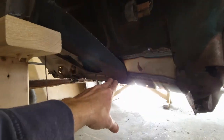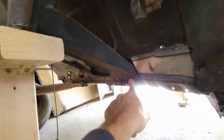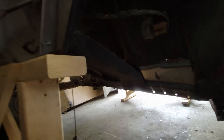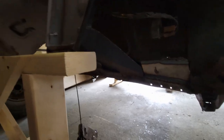One thing that we have to do is this bracket. There's a bracket on two sides. The punch will only go through sheet metal, so this is heavier gauge, and this one has to be hand drilled. So I'll have to drill this out. And there were some other spots over here that had some things in the way, so I'll have to hand drill those. But you can see now I've got all the holes punched,